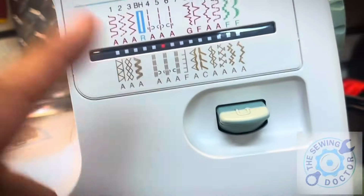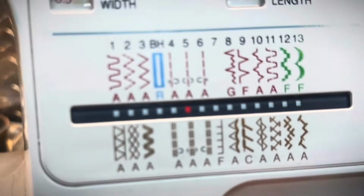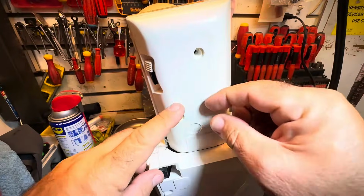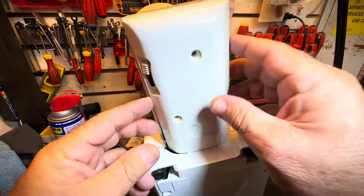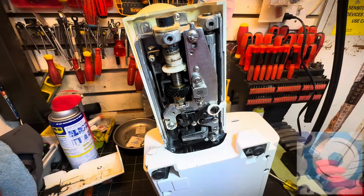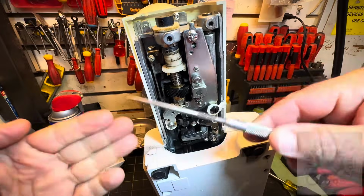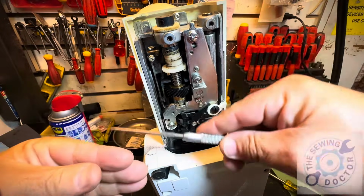But if you have a machine that is not feeding correctly, and when you press the feed dog here it's not going to work, of course, the problem is that the feed dog is too low. Let me open up and show you. Now take the covers off. I took the 2 screws out already, and I want to show you exactly what I wanted to point out to you. Now the feed dog is not going past the needle plate. It means it's flush with it.